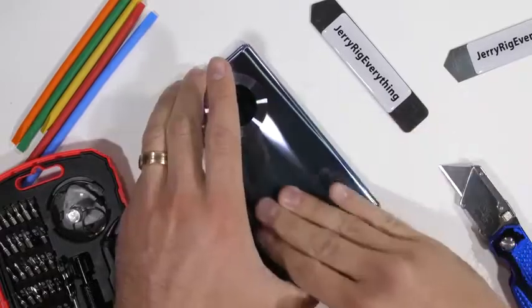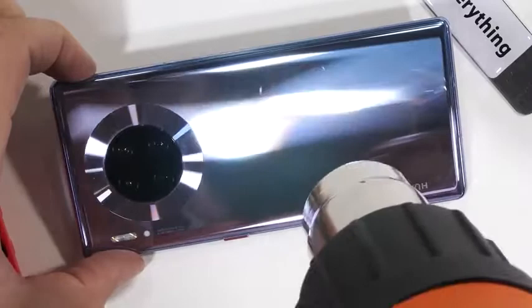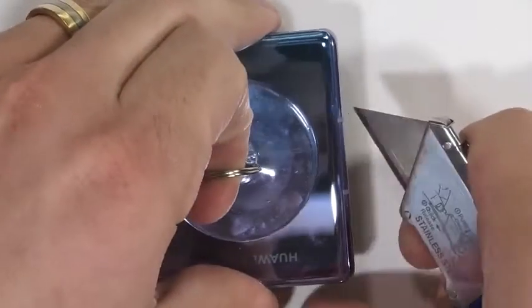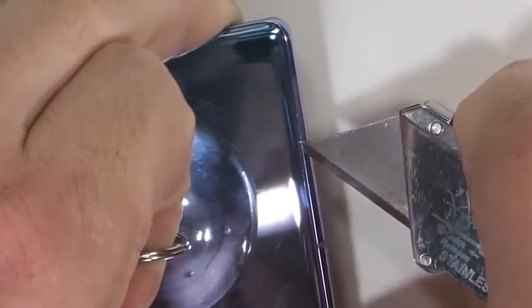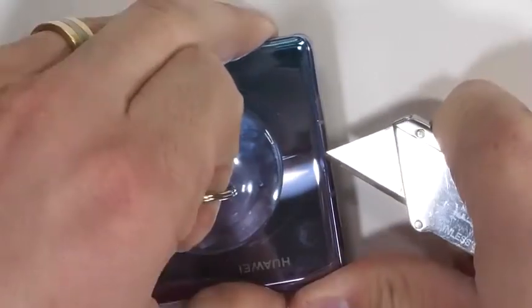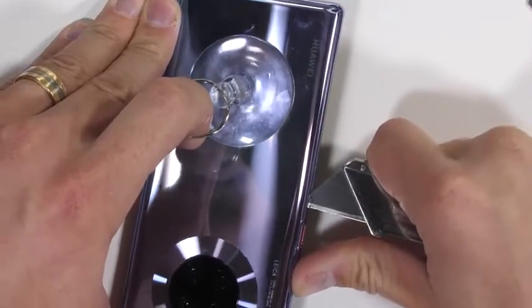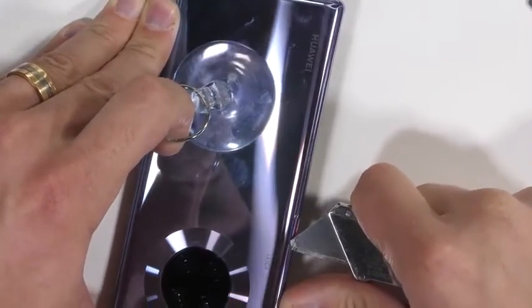Removing the glass on glass-backed phones is sometimes pretty difficult. One little trick I like to use when the adhesive is super strong is to insert my metal pry tool or razor blade next to the softer plastic antenna lines. That little section of plastic is much more forgiving than the super tight tolerance between the glass and the metal frame. There are machines that do this as well, but unless you own a cell phone repair shop, a hot plate glass suction separator machine is probably not very high on your Christmas wish list.